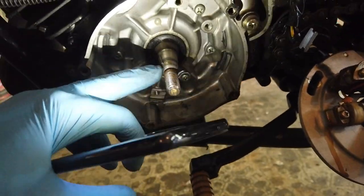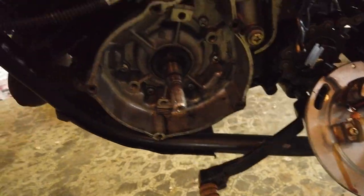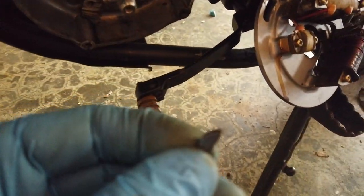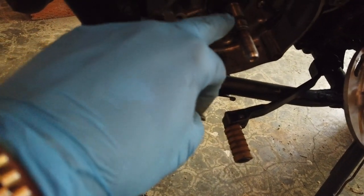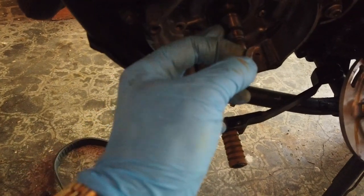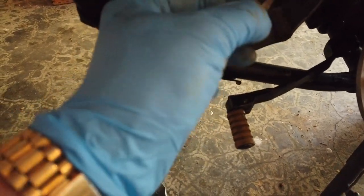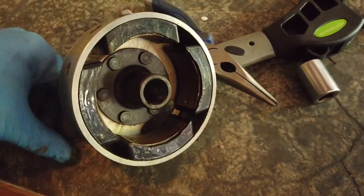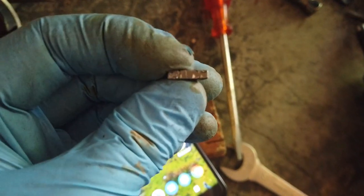You just take a small Phillips screwdriver, tap it towards the edge and it should pop out. To get the Woodruff key out, take a screwdriver blade going lengthwise — not breadthwise — a smallish one, and just tap it at the bottom side gently. Keep going — you're pressing it in, it's a half moon, and it'll slide up the other side and pop out. Always replace it — you could reuse it, but I never do because you can see the top where I've hammered it.